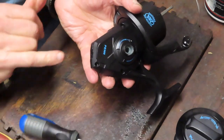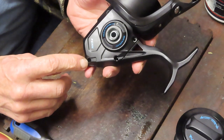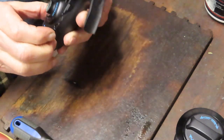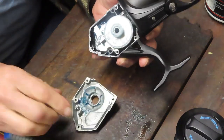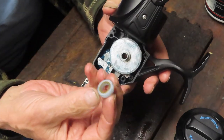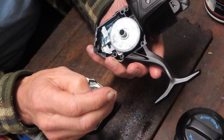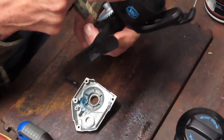So what did we do? We removed the bump guard — that's the shield there. We found that there's a screw under that shield, and then there were three other screws. I've put them into a little parts container off camera, and that parts container just keeps them in a single place where I can get them later. Well, here's a surprise — that's not a bearing. That's a bushing. So we have a bushing on this side.